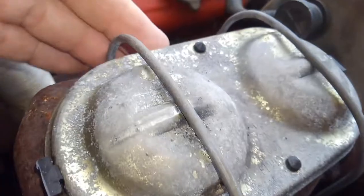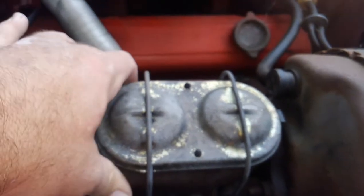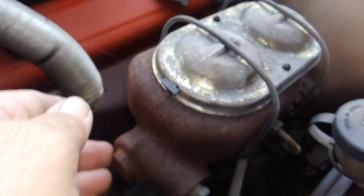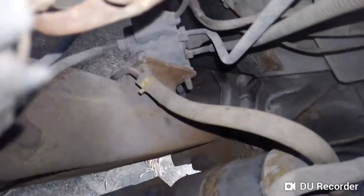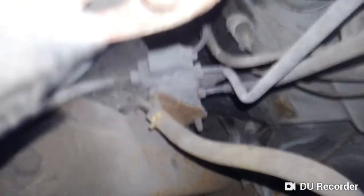The Corvette has a dual reservoir system on the later cars — the earlier disc brake cars did not. You've got lines going out here to a proportioning valve back there. That valve distributes the brake fluid from front to rear — the front gets more braking power than the rear. There's a switch on top of that valve that's what tells me there's low brake pressure in the system. That's the basics of the system, not very complicated by today's standards.